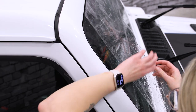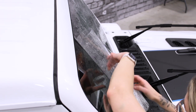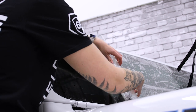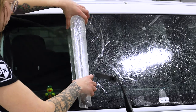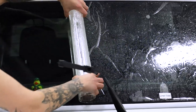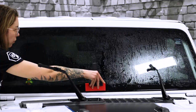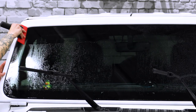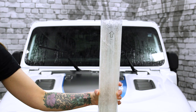It's time to get your piece of ExoShield Ultra ready for application. Head back to the same side you began releasing the liner on and this time release the film from the windshield — you should have both the liner and ExoShield Ultra in your hands at this point. Roll the ExoShield and liner in towards the middle of the windshield, making sure the roll stays square to the windshield as you roll it up. Now that you have the entire piece rolled, clean the windshield one last time before application. Make sure to keep track of the orientation so that you know which is the top and which is the bottom edge.